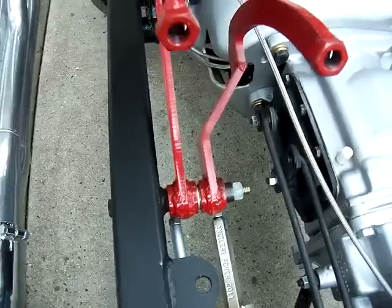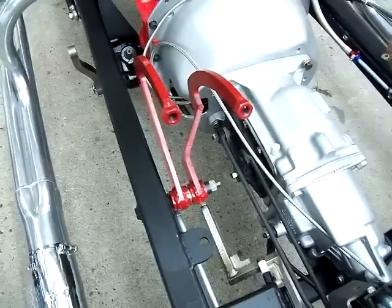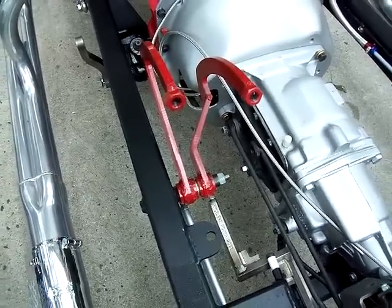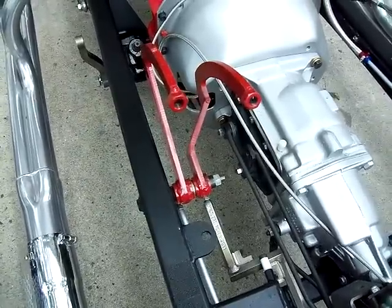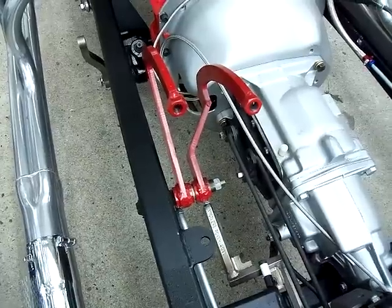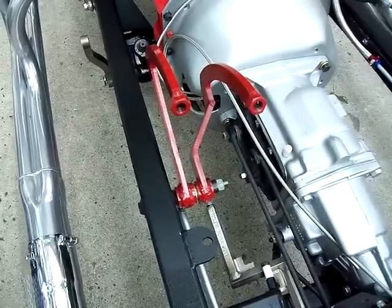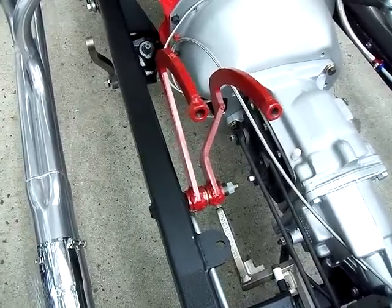We ordered an extra pedal from Josh. He had an angled pedal. We cut it and sliced it. It clears the floor, it clears the bell housing. What we did for the pedals as far as the bearings is we ground off the posts that they were mounted on. We ordered 1/2-inch bearings. They're 1.1 outside diameter, and we got a piece of 1.1 inside diameter pipe, cut it into 5/16 slices, and welded them on the pedals, and then used spacers between them, and it worked out nicely.